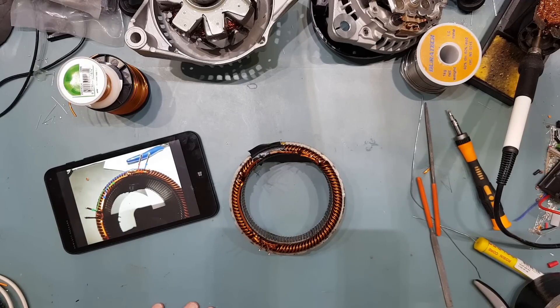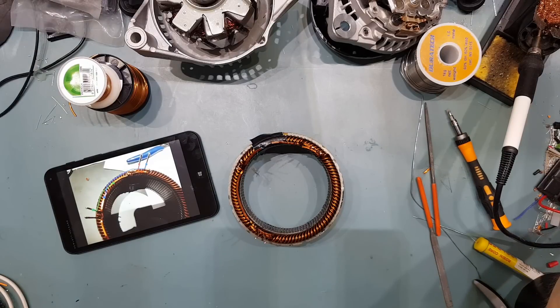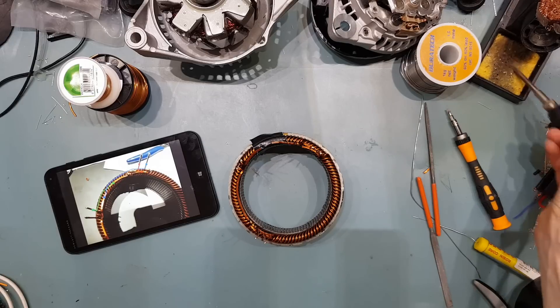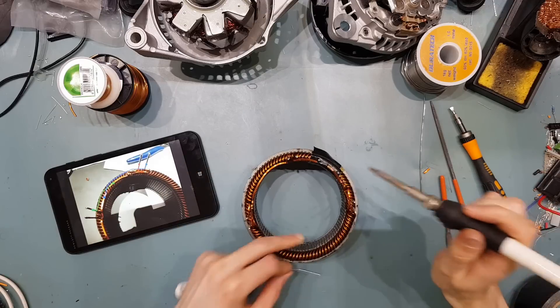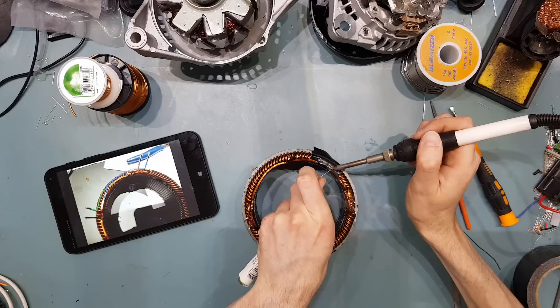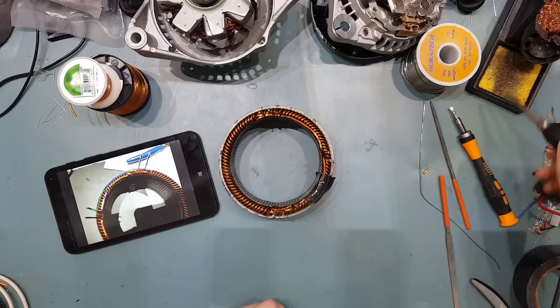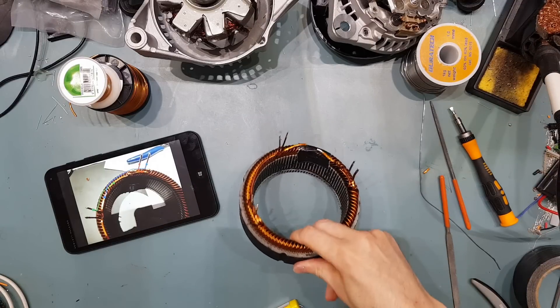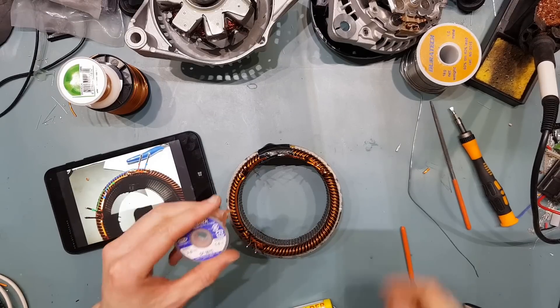So that's pretty well cleaned up. The enamel has gone off of there. One thing I've been doing with these is using lead-free solder, because it has about a 50 degree higher melting point than lead. So if there is excess heat in the alternator, it shouldn't cause the solder joints to fail. I try to take the enamel off of all four sides of the wire, and often I will have to have another go at it because you haven't got it all in the first go. Another thing I will often do is when I first tin it, I'll whip the solder off again — that way I can see where I haven't removed the enamel properly.